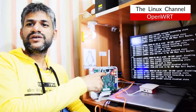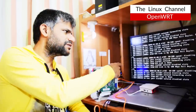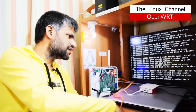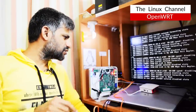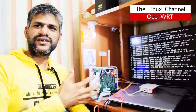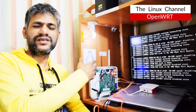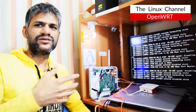So to cope with this, what you need to do is configure one of the ports. Currently it is not getting an address via DHCP, so you need to initialize that other port. I need to check how to do the same, and I need to have a look in the OpenWRT /etc/network config how to do it. So I think they have not done it as a part of the default setting, so I need to have a look, and I can enable DHCP or something. So once I do that, what happens is it should support routing.